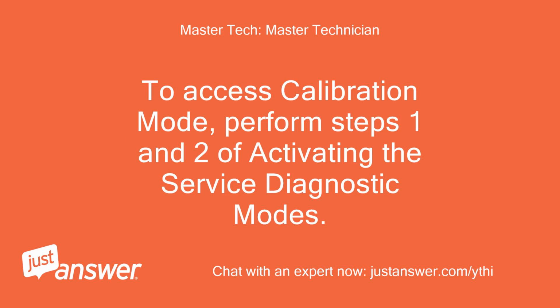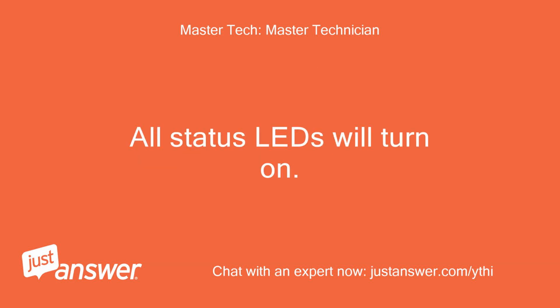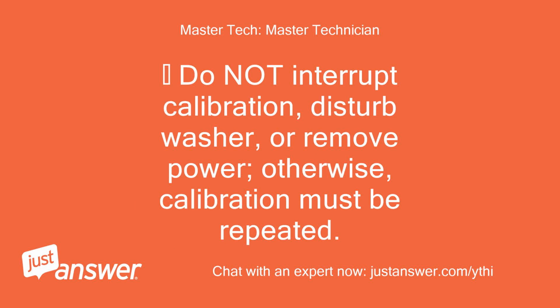To access calibration mode, perform steps 1 and 2 of activating the service diagnostic modes. Turn the cycle selector knob until the status LEDs or display correspond as follows: rinse LED on, O4 displayed on 7 segment. Press the start button to begin washer calibration. All status LEDs will turn on. Do not interrupt calibration, disturb washer, or remove power, otherwise, calibration must be repeated.